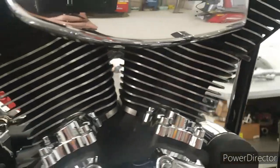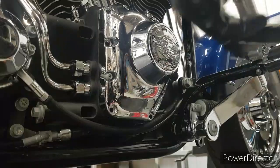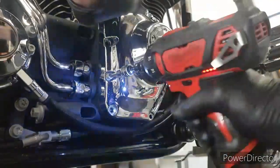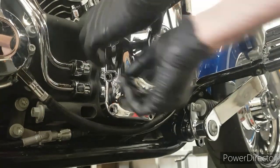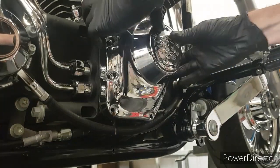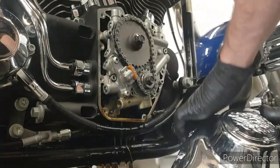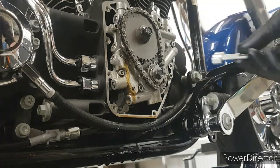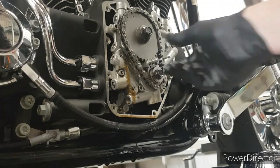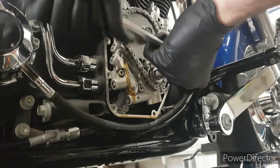So that's all out of the way. We get the O-rings out of those — we're going to replace all the O-rings. Those lifter blocks have got to come off later anyway, but we'll get this cam cover open and show you guys inside there. Once we get this cover off, we're going to undo everything in there and block off some of the oil drains for the pickup for the oil pumps.